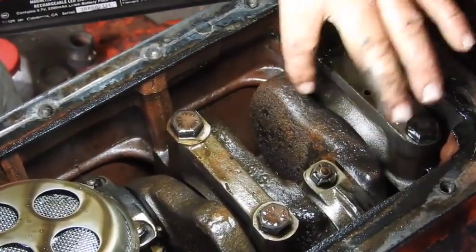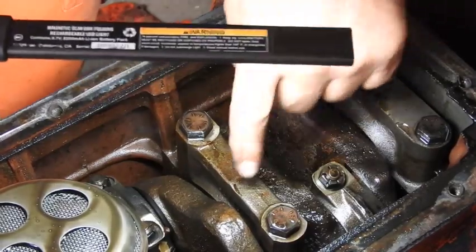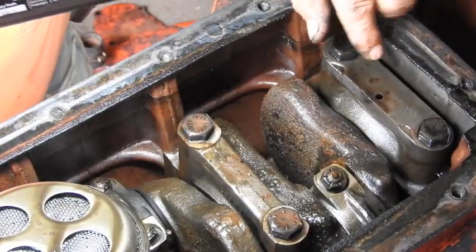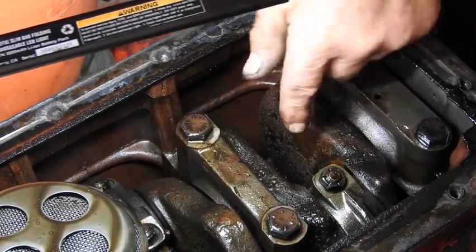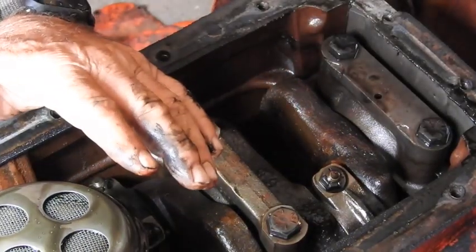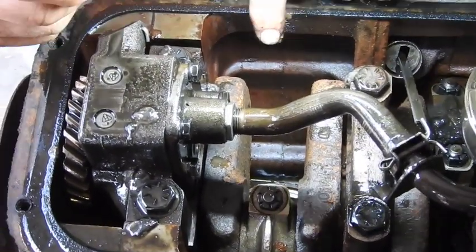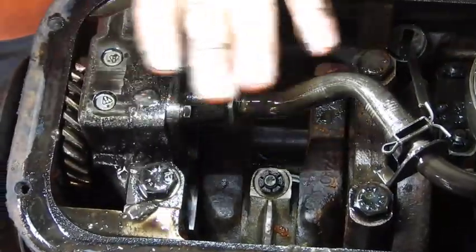The crankshaft goes through the center here, and these are the offset parts that counter the force of the piston. There are your connecting rods and the rod bearings. These are the main bearings — this engine has five sets of main bearings, which is really good because that keeps the crankshaft from flexing. But there is some rust right over there — covered in rust here, but it's not bad at all. There's a little rust on the bearings, but all this has to be disassembled. Cylinders two, three, and four look pretty good, but come up here and look at number one — the entire connecting rod is completely rust-filled all the way down. I can see rust coming out of the bottom of the piston. It's an aluminum piston, but there's rust coming down the sleeve on the outside of the piston.